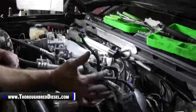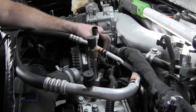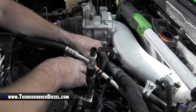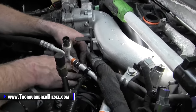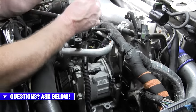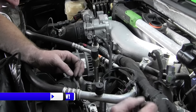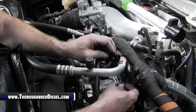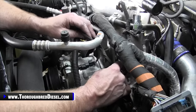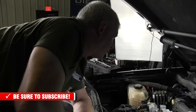All right, our last little wiring harness here is for the AC and the last connection for the alternator. So this just kind of goes down underneath of the AC lines and routes, and you've got a little clip that goes to the AC line there, and it's got a mark on it. The orange grommet connector, 2-pin, is the sensing wire for the alternator. Then you have three connections at the AC. You've got the pressure switch first, or pressure sensors, there. And then on the AC wires, it's color coded, so the green and black go to the top connector, and then don't forget your safety catch there. And then blue and yellow goes to the back connector. And there you go. That's everything wired up and ready, save for the air box.